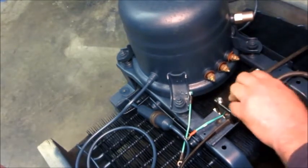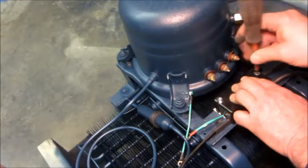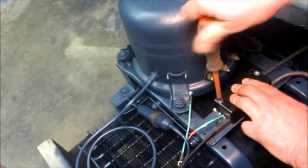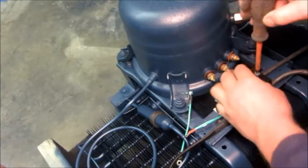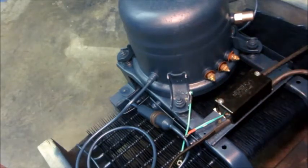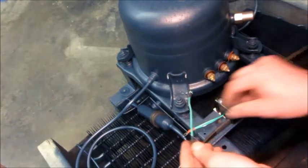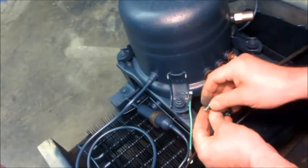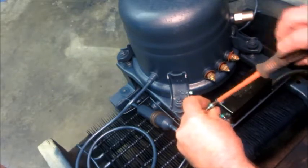Just checking to make sure no wires are underneath the relay getting pinched or cracking the relay housing. Should be able to run these down now. That's got the rebuilt hot wire relay with the PTC device in it. Now I'm going to take these other two grounding wires — that fitting may be a little bit small, I'll probably go ahead and run the screw through that one to start with and get it in there.